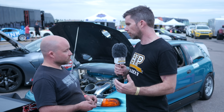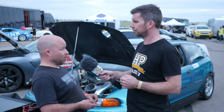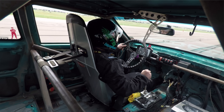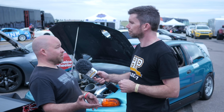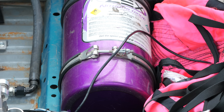So the idea is you're not really relying on that traction control solely — you're really trying to tune the power delivery of the car to suit the track, and then relying on traction control as a safety measure just in case you do break into wheelspin? Correct. I always think in terms of torque: in first gear I can only put down maybe 400 foot pounds of torque with the current setup. Second gear I can get 500, maybe 510. Third gear I can get it closer to 600 foot pounds. By the time I get to fourth or fifth gear, I'm putting down everything that the motor can make — so 700 plus, and with nitrous I'm assuming over 800 foot pounds.